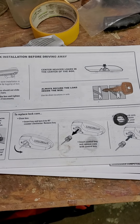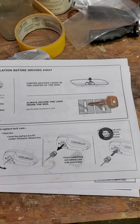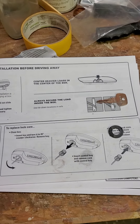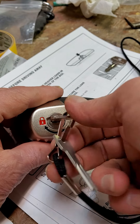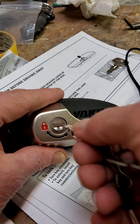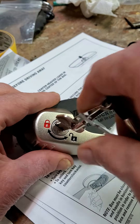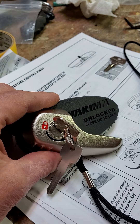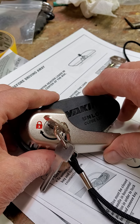Then you need to have a control key, like it shows in the directions, to remove the actual lock cylinder — the core — as if you were changing out cores. Right now, if it's in the locked position, I can remove the key. If I go to the unlocked position, it won't let me take the key out. Consequently, I have to carry the key around with me all the time. So we're going to remove this core and I'll show you how to fix it.